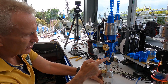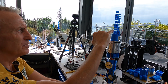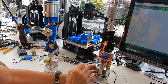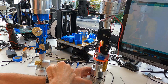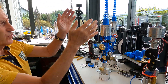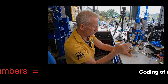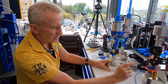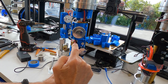What we're looking out for is this to move forwards and backwards and for an ignition source to be sent up here. I'll show you what happens on this one — it's the same program running: slight movement, ignition, and full throttle. So that's the program running on this one. For the full throttle on here, I need to reprogram and put different numbers in because we've got a different ratio, and I need to go the full 180 whereas I'm only going to about 85 degrees to get the necessary deflection.